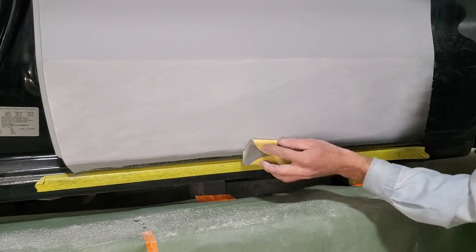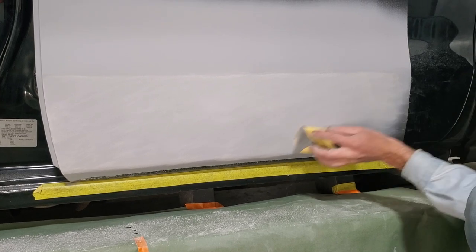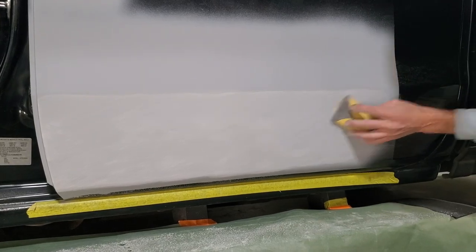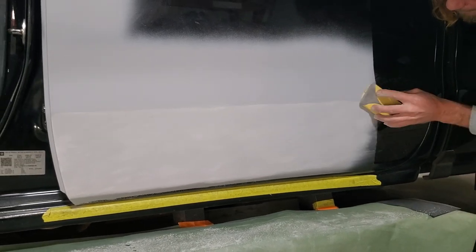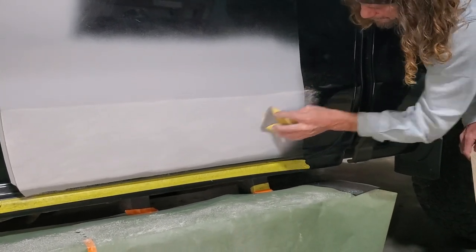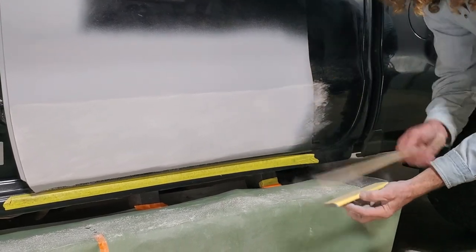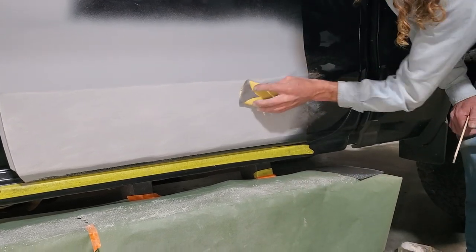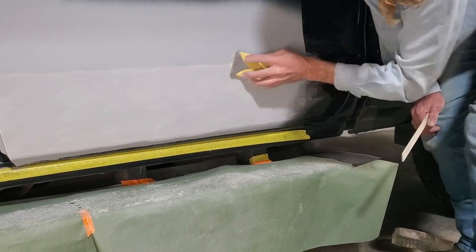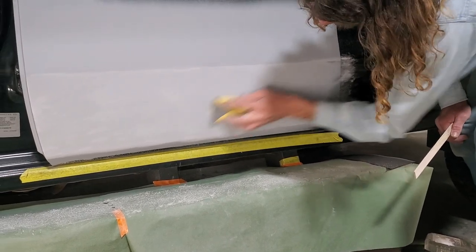After the 400, it should be ready for paint. Just a little more on these edges right here. You don't want it to feather in — you'll sand all the paint or primer off of where it wasn't sanded previously. I'll show you where that's going to be at. You'll be able to tell the difference in the way the primer looks and the paint looks.